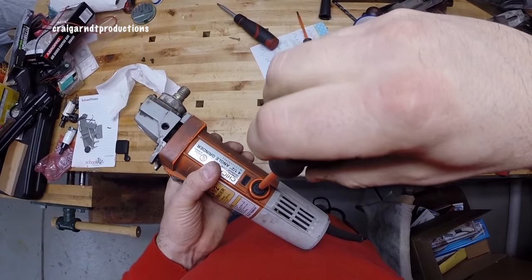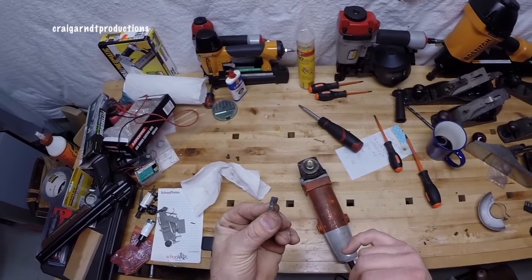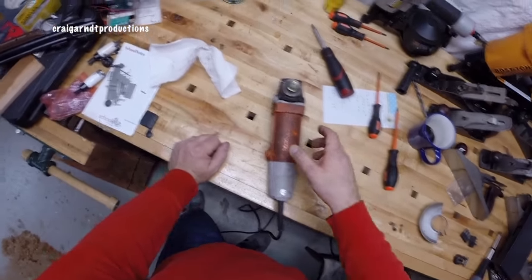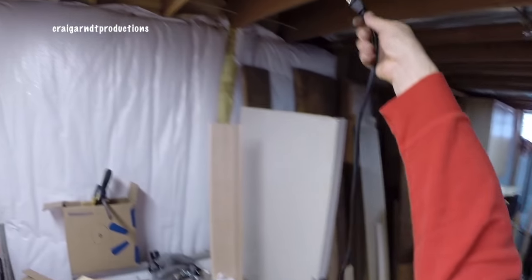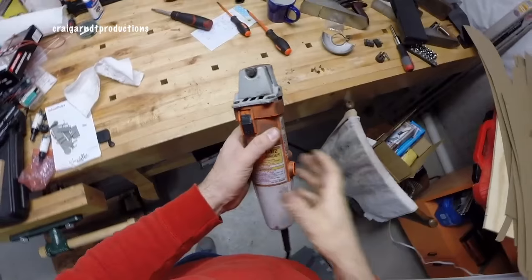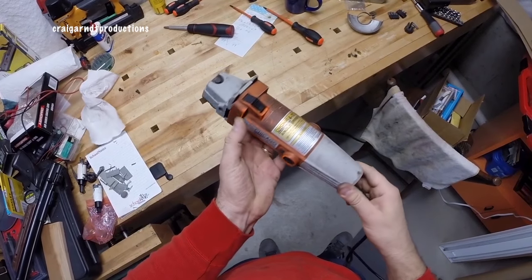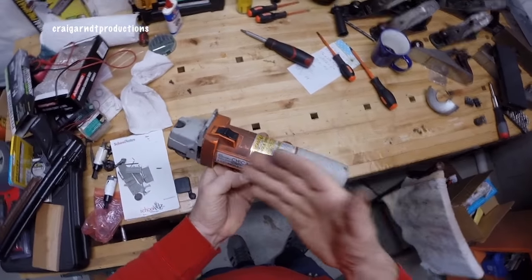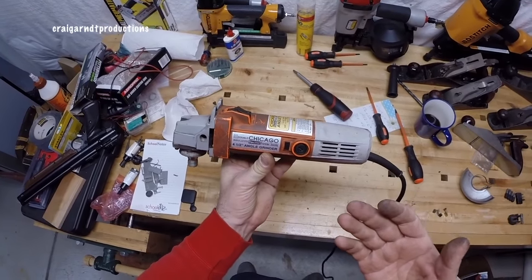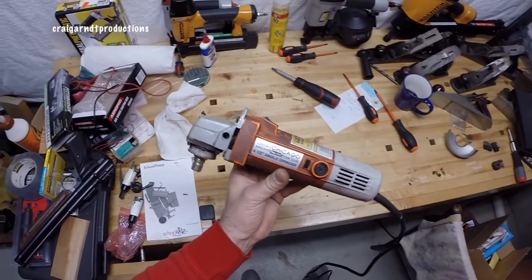These new brushes are going to require a break-in time, so I'm going to see if I still have the owner's manual. This old one had about half its useful life left, so we've got our measurements so we can go on Amazon and figure out where to buy them. First, let's see if this works — let's plug it in. If these don't work, the first thing you do is check your brushes. Hopefully now you know what's in the guts of one of these Harbor Freight grinders — and pretty much the same in any of these grinders. For $16 or $17, you really cannot go wrong with these.